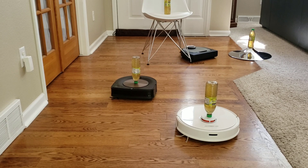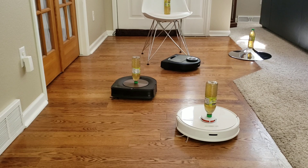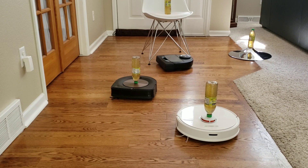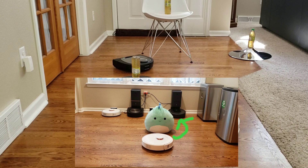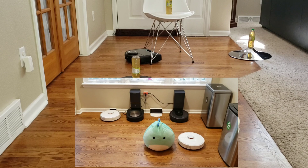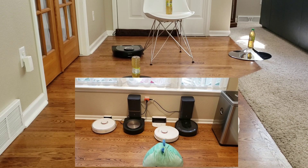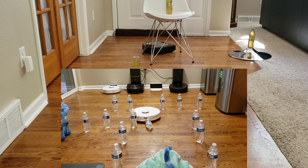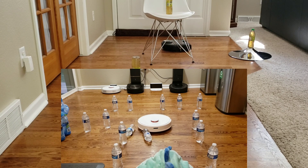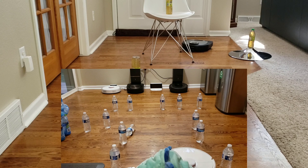Here's where the Roborock S6 and S5 kind of outperform their competition. Even though the Roborock has a physical bump sensor, it also relies on its LiDAR sensor to predetermine where objects are. The algorithm can judge how far away objects are and the robot can go around them without physically bumping into them. The benefits are: it won't harm your objects, and it's more efficient. The only downside is that LiDAR lasers tend to get hung up on clear objects like glass panels, and also on black objects because the lasers don't reflect off them — so sometimes the robot will not detect that object and run into it harder than it should.